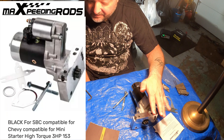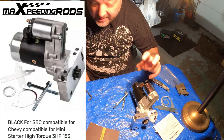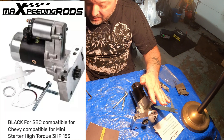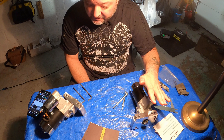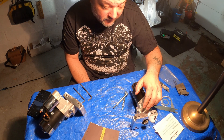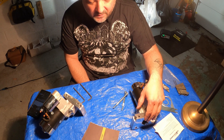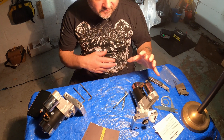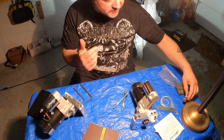This is their small block Chevy compatible mini high torque starter. It's claimed to be a three horsepower high torque starter compatible with 153-tooth and 168-tooth flywheels for small block Chevy — so that covers everything from the 302 all the way to the 400. Depending on the flywheel and the number of teeth, this is fully adjustable to work with either application, so it's universal, which is fantastic.